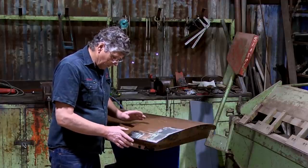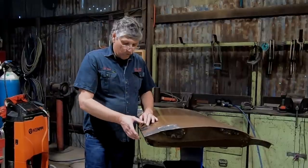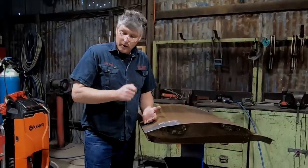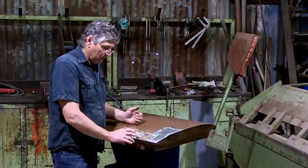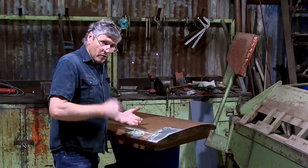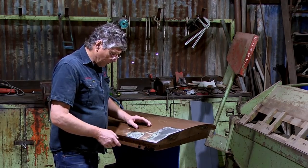So we're going to look at this patch panel here. Everything I've said before works for these. You can hammer the weld, get the dolly underneath it, give it a good hammering and work it, but because it's a lap joint you're going to have to hit it. It's not a case of tap tap tap — you're going to have to belt belt belt to stretch out that lump of metal and actually bring some semblance back to the door.